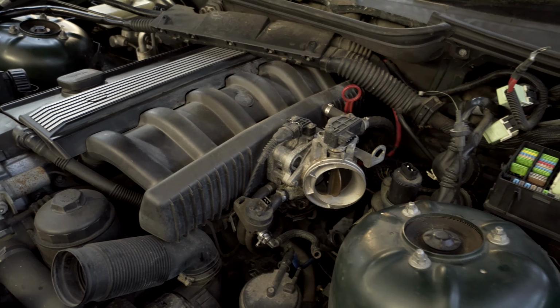I think quite a few other bits still have to come out of here. I'm not 100% sure. I think there are bits and pieces that aren't similar, but what I do have now is the ability to go out and look at the M3 coupe shell and directly compare, because they're in roughly similar condition. So I can see what is here that isn't on the other one and vice versa, and start swapping over bits if need be. I can already see this bracket would hold the expansion tank on the S50, but here it's holding, I think, the traction control valve, so that's probably going to have to be ground off here and then swapped over. So there's a few bits and pieces, but hopefully nothing too major. And it should clean up pretty nicely.